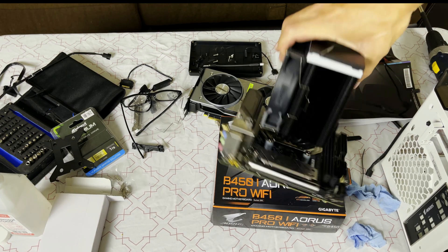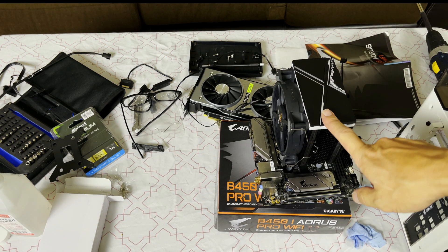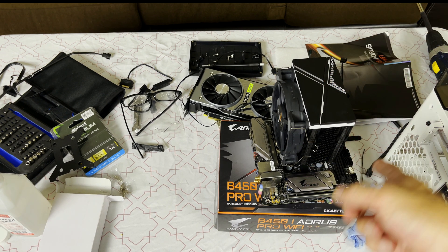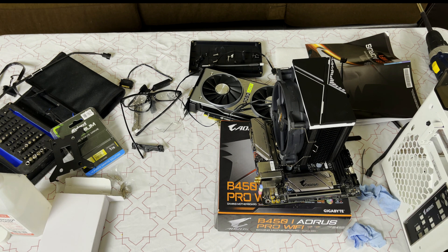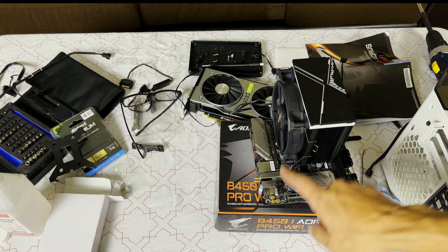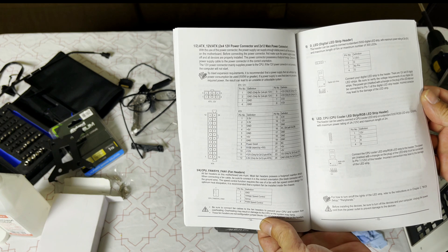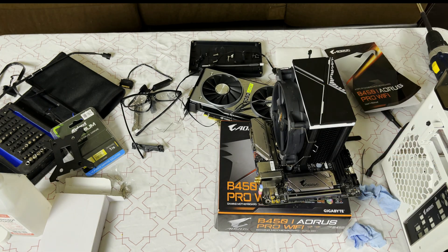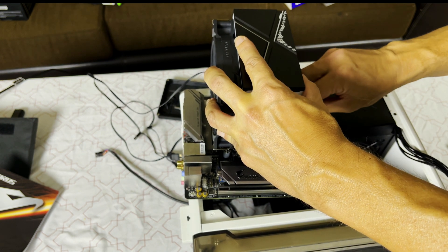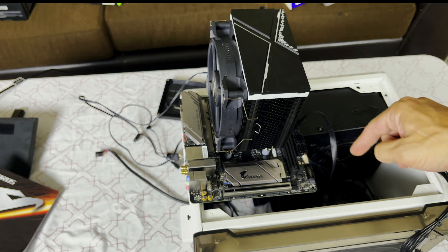With our fan now on here we're going with a pull config — pulling air through the cooler. Now we can start the fun part: installing all the wires onto the motherboard before we put the motherboard in, because that's pretty much the only way you can do this. Once it's in the case it's really hard to get down in there to reach these connectors. Have your motherboard manual ready and get to the page that tells you where everything is. Let's clear up our space — take our front panel connector, find the way it goes in, and plug it in. I try to get as many wires connected as possible before it goes in the case.